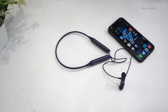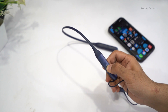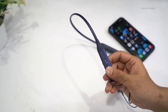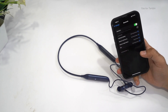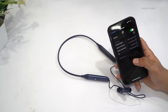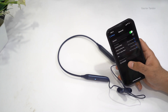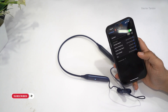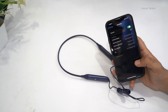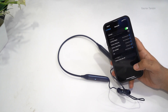Now I'm going to show how you can connect these earphones with your phone. Press and hold the middle button to turn them on — the white light will blink and then become stable. Go to Bluetooth settings, it will search for the device, and the light turns blue on the earphone. Select 'JBL Live 220BT' and it will go into pairing mode. As you can see, the earphones are now connected with my phone. The setup process is pretty straightforward, just like any other earphone.